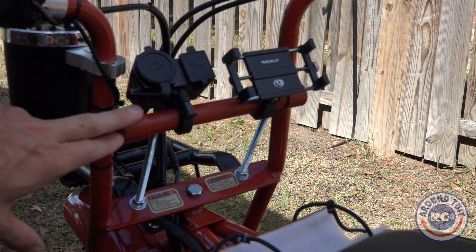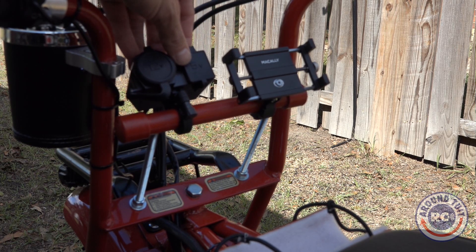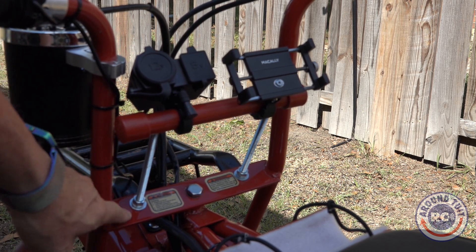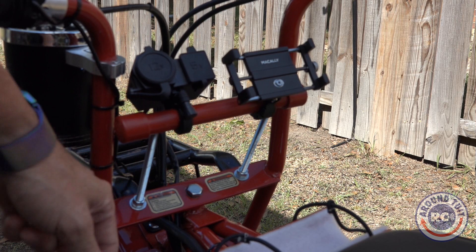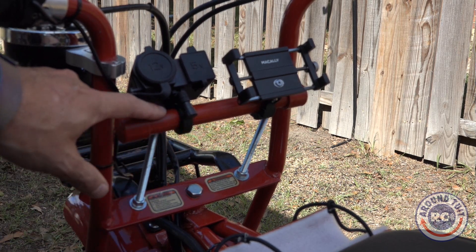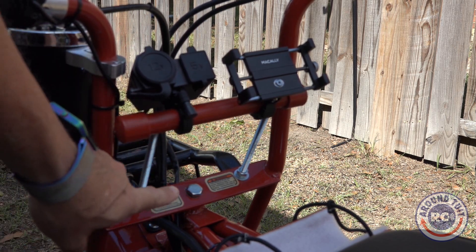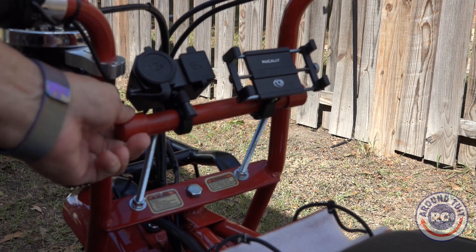I basically came up with this mounting system on my own. It's made to hold the 12-volt accessory port, the 5-volt USB charging station, and the bike mount cell phone holder. I took the bolts out of the bike that hold the front rack on to the main part of the handlebars — that's a 5/16 by 6-inch bolt. This is a piece of half-inch PVC piping with caps on it, painted red to match the minibike. I drilled holes in the PVC just slightly smaller than the bolt size so I could thread the bolts onto the PVC — it's a very sturdy mount, it's not going anywhere.